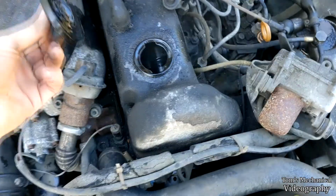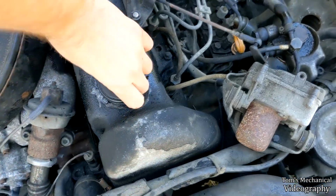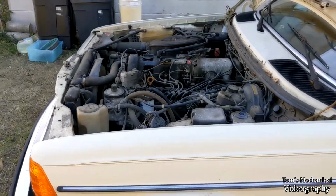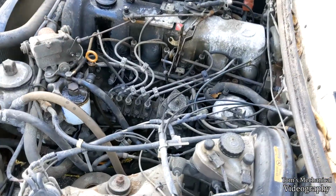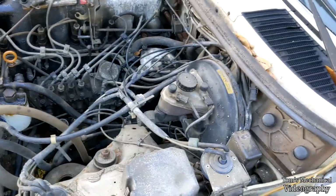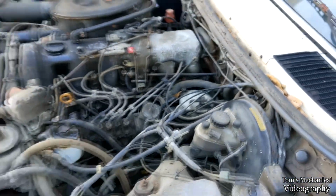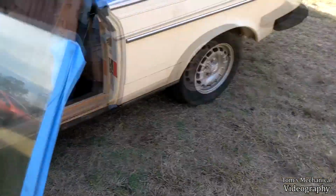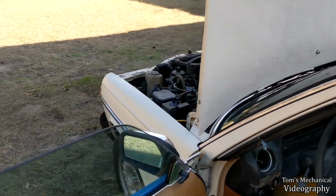See, the blow-by isn't terrible. It's not great, but it gets worse the hotter the engine gets. So I think if I can actually get the cooling system working, the compression will stay at a tolerable amount. Or at least that's what I'm gonna lie and tell myself. And if I can ever get one of those, I can actually test to see if the transmission has all the shift points, but I am low on fluid, so I guess it's a good thing I have to do the radiator, because I'm gonna have to do the transmission fluid anyway.